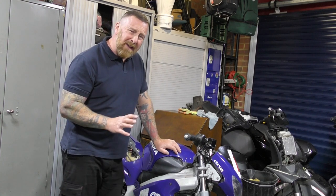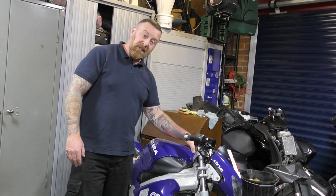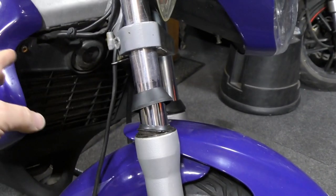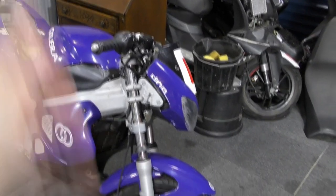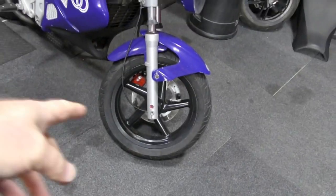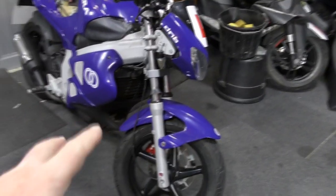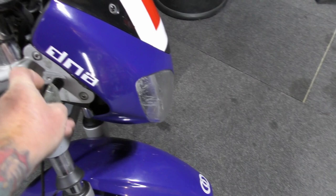It's got its usual little bits of damage around it. I'm not going to spray this one up — the clocks are quite nice and they do go. Being on a side stand and still needing to drop the forks, I'm going to have to build a bit of wood, jack the whole thing up off the floor, and then drop both of them out — taking away the speedo, drive cable and brakes — to replace both. Don't bother just doing one.